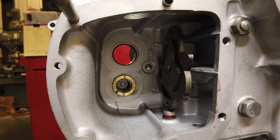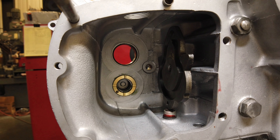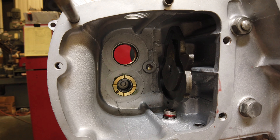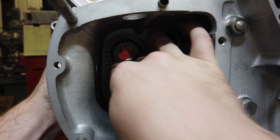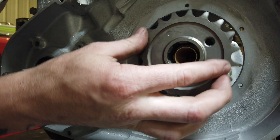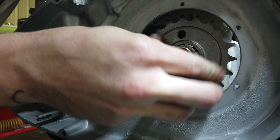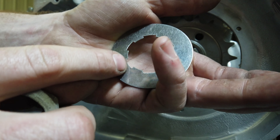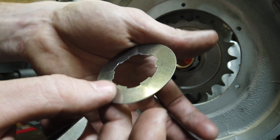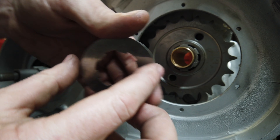The next step I like to do is put in your fourth gear. That's the first step no matter what, but I also like to install the new sprocket when I do that. Because there's been times when you might have fitment issues or whatever — you want to get that figured out right away. A lot of times when I'm putting in new sprockets and new tab washers or whatever it might be, sometimes there's something that gets in the way, so I like to do the full sprocket installation right now. Tab washers — you have to file the corners because they just stamp these out and they rarely fit nicely. I usually take a square file and just clean up all the corners, and then it goes on way easier.